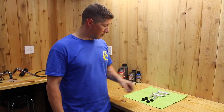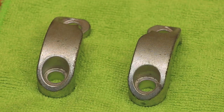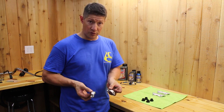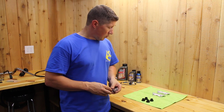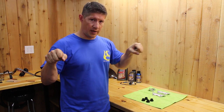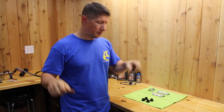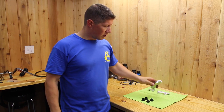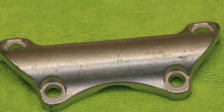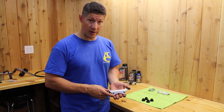This is an 07 model, so it comes with two individual riser clamps — or straps, as I call them. They go on the bike and that's what holds your handlebars down. When you go to taller handlebars, it puts more leverage on that riser clamp, so you need something to clamp better — you need more surface area. In 2008, Harley started putting a full-width clamp on from the factory, so it's all the way across instead of two individual pieces, and it gives you much more grip and does a great job.